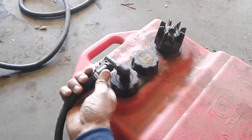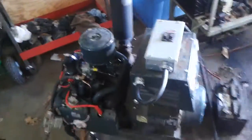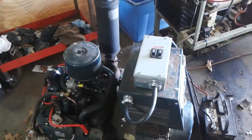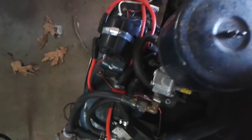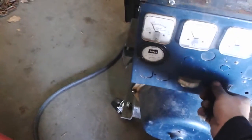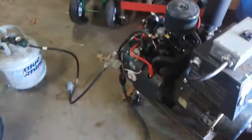We'll cut that off, disconnect the fuel line, and just let it run right out of fuel. The carburetor is now out of fuel and we're unhooked. We'll turn it over a little bit more to make sure it's empty. Now we'll hook up the propane.